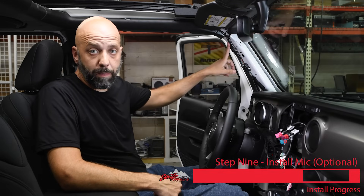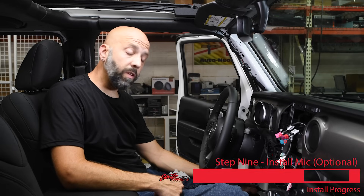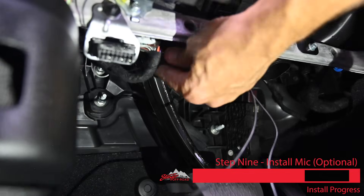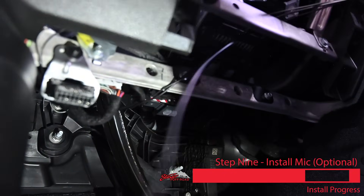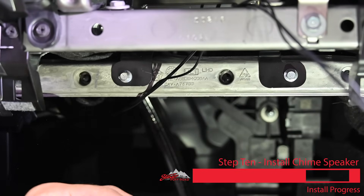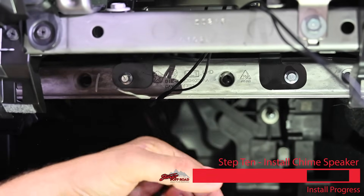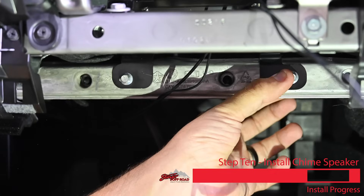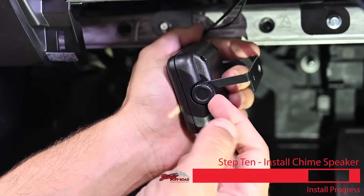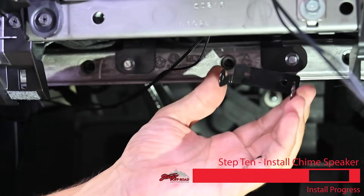Now with the external microphone cable and the GPS antenna routed to the A-pillar, we're going to finish running them down the A-pillar to where we're going to mount the chime module under the dash. Under the steering column, we have a convenient place to mount our chime module — basically bolting it right to this bar. It does have an included mounting bracket with two holes. Some Jeeps do not have this bracket populated, so if there's an empty hole you can take the bracket and supplied mounting hardware and simply thread it through the hole. Because this Jeep does have a bracket, we'll remove that bolt and use it to attach our mounting bracket. First, take the bracket off of the chime speaker, then remove the existing bolt and reinstall our bracket with the bolt.